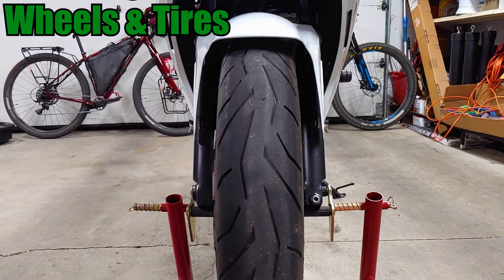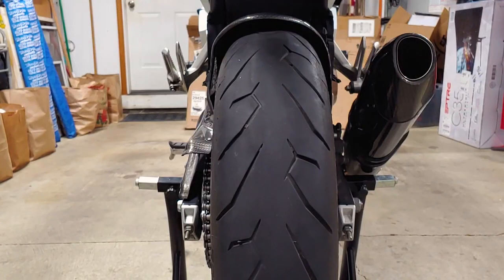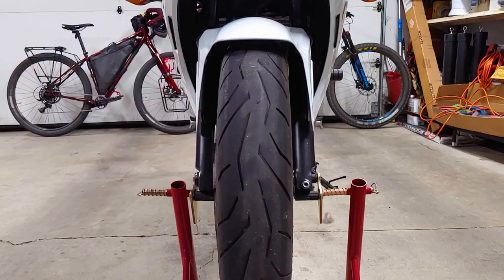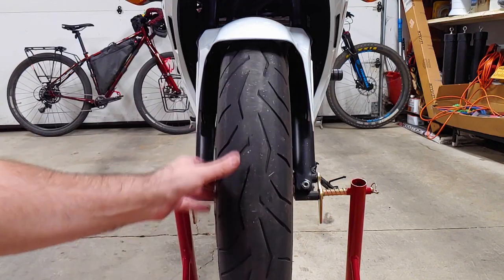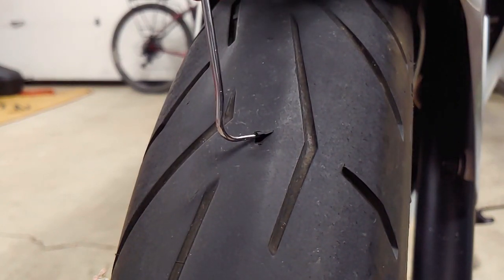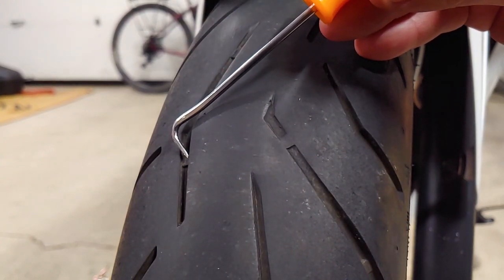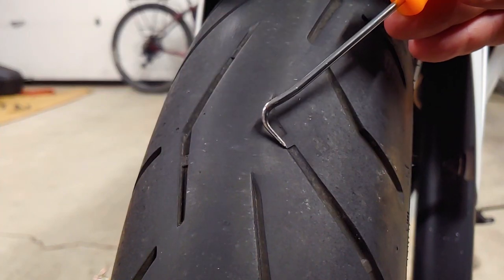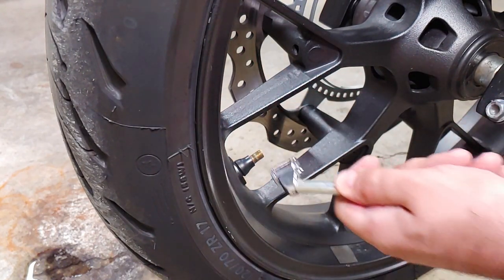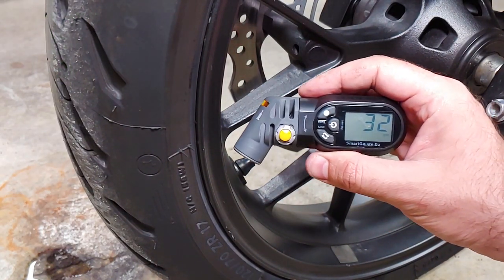With the motorcycle off the ground, grab onto the suspension fork and shake the front wheel from side to side to check for worn wheel bearings. Check the rear wheel too by holding onto the swing arm while you shake it. Carefully inspect the tires and rims for damage and trueness. The tires should be replaced when they have significant damage or when any part of the tire is worn down to the wear bars. With cold tires, the front should be inflated to 36 psi and the rear to 42 psi for the 500R, 500F, and 500X.